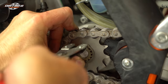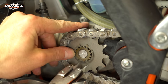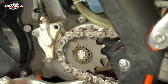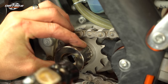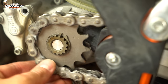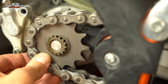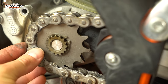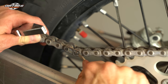Just putting the snap ring back on. You have to push the sprocket back onto the shaft, and I use a socket here — just bring up a socket and gently tap around it to push the sprocket back in place and get the snap ring to pop all the way down into the groove. The socket worked well this time to gently tap that thing back and get the snap ring set in place.